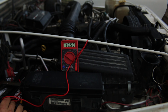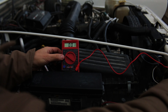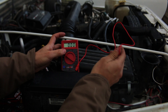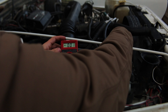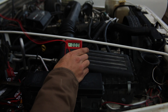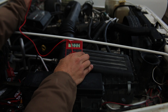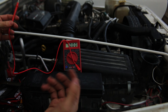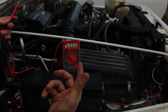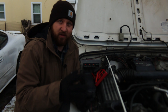For sanity's sake, we're going back to the battery to make sure we're working. Voltage looks just as not great as before. I have the negative probe on the battery negative and I'm touching the body — we have 0.01 volts. That's really nothing; I could probably clean the ground a little bit, but it shouldn't cause an issue. Going to the alternator — 0.01 volts there too, essentially zero. And then up here to the grounding bolt — 0.012 volts. There is a tiny bit of voltage there, but basically zero. Now if this number were one or two volts or higher, you'd want to clean or replace all your grounds — that would be a problem. But in this case, we don't have any voltage feeding back through the system.